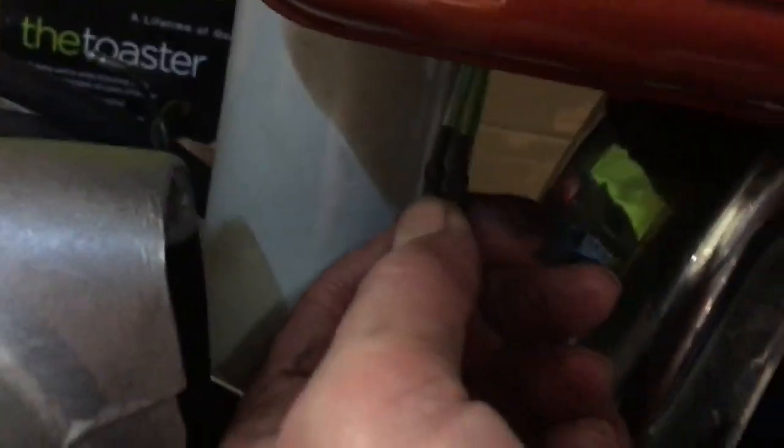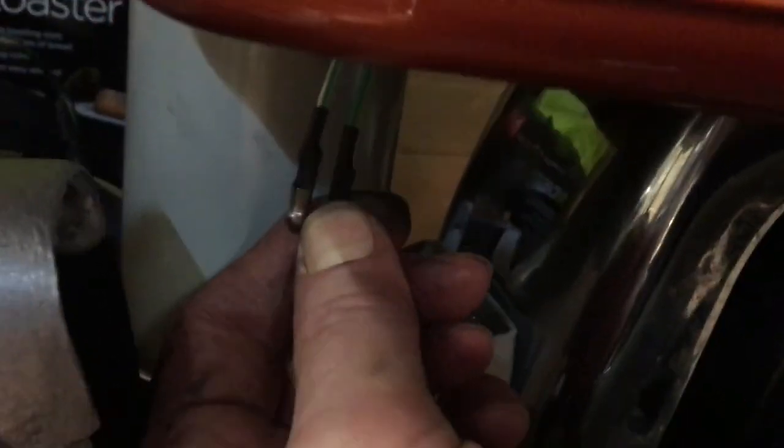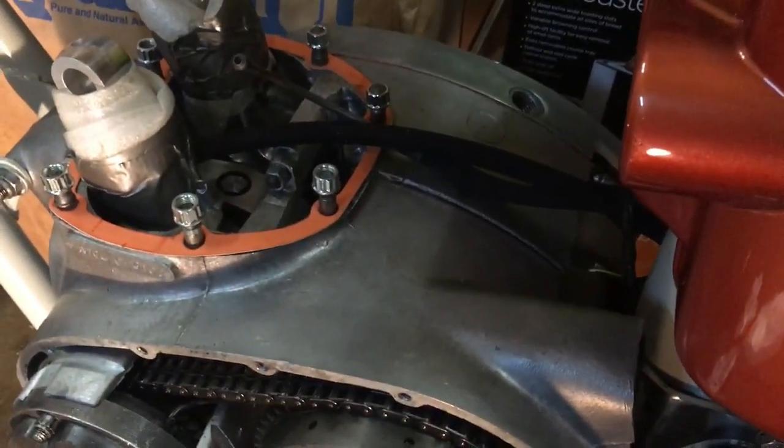Okay, there we go. Wires out and routed through correctly behind the sprocket back plate, so that means it's well away from the sprocket and isn't going to get rubbed. They're protruding there, and those tie into, where are they? There they are. The two bullets. Whoops, here we go. The two bullets there with the colour-coded wires down from the main loom. So we just need a couple of bullet connectors now and we can connect them up.